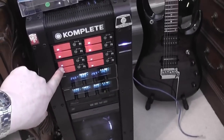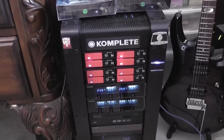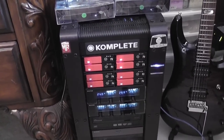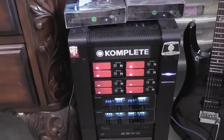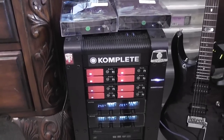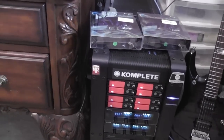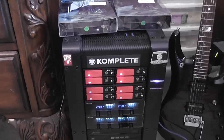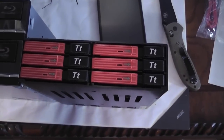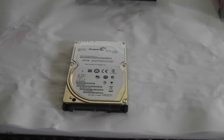I've got these two drives, or volumes rather, for my input and output files for After Effects and Premiere. The way things render faster — the fastest thing you can do is never be reading and writing from the same volume simultaneously. So basically I'm going to have these two as my input and output files and use this third set of disks as my operating system.